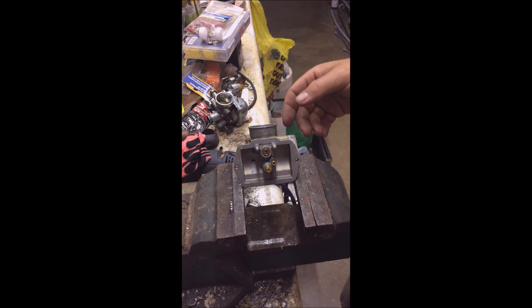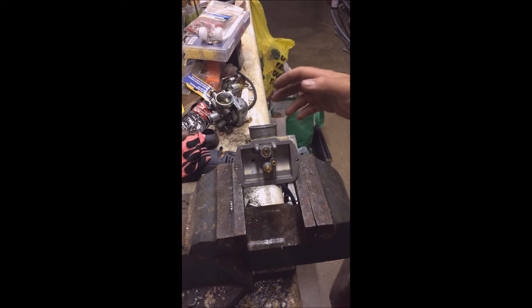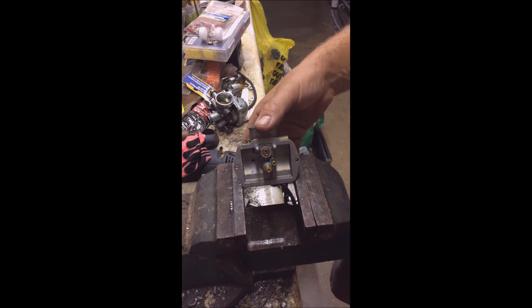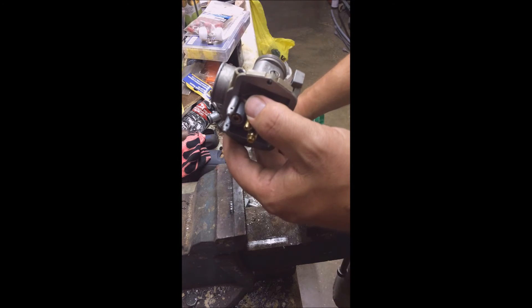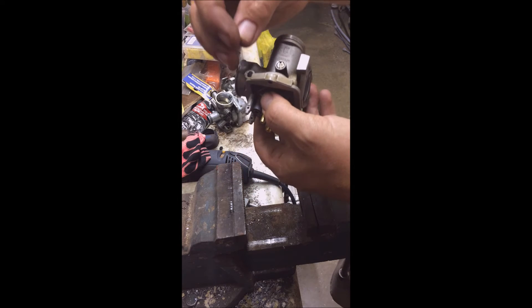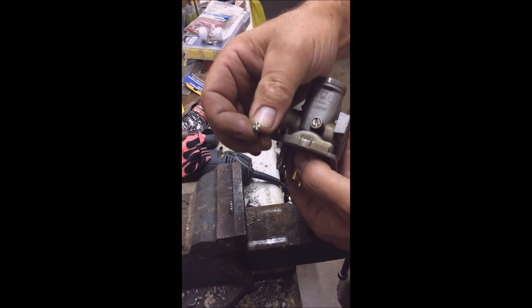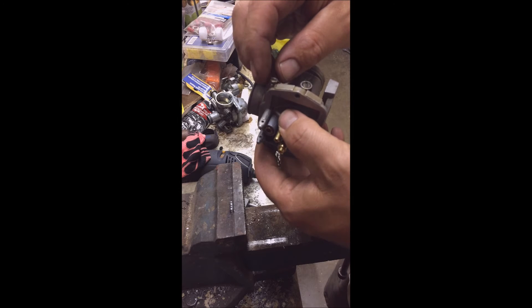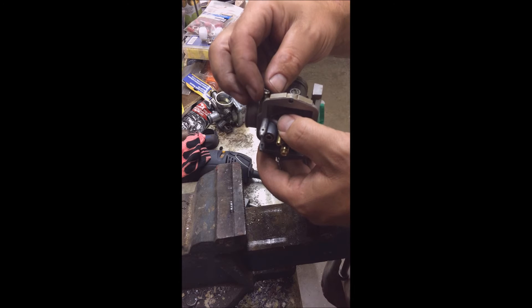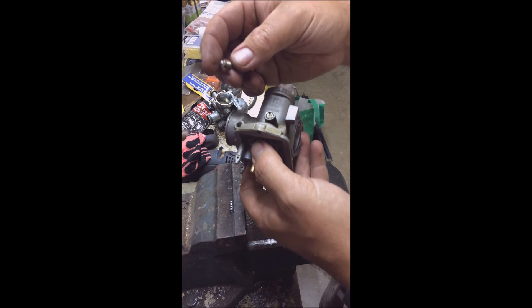It's cool enough to touch now. I put this all back together — at first it didn't leak fuel — but I couldn't get it to run. For the life of me I couldn't find the adjustment for the air screw. Partially because one of the screws I was trying to adjust would not move. As you can see, I've really buggered up the end of this. I was able to get it to turn about an eighth of a turn on the machine — beyond that, nothing. I elected to take it out to get at it better, but I still wasn't able to turn it anymore.